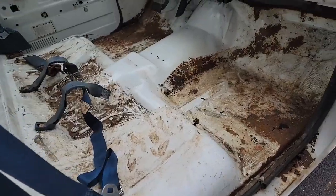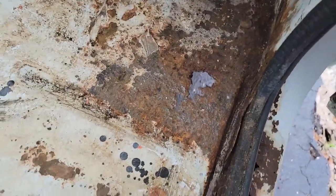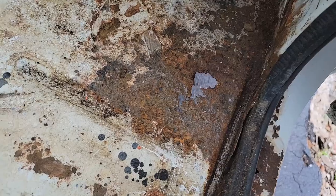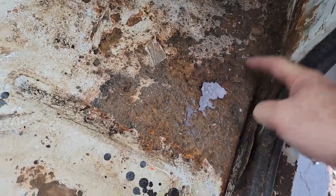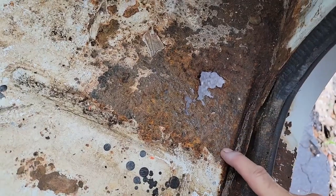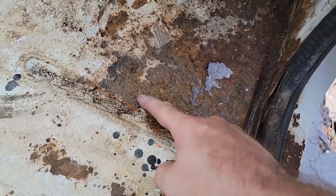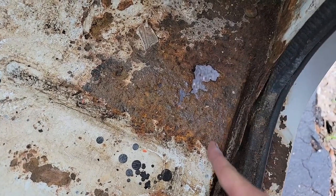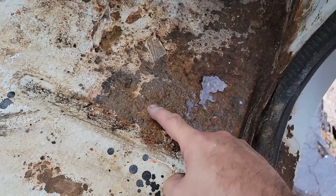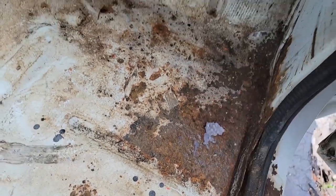Back on this side — I knew there was a hole in the floor and we knew about this. But this hole in the floor couldn't be in a better spot. It's pitted and crusty but it is solid through here. There's a body line here — I can cut right here along this line. It's just a flat piece — patch that in, rust convert it, we're good.